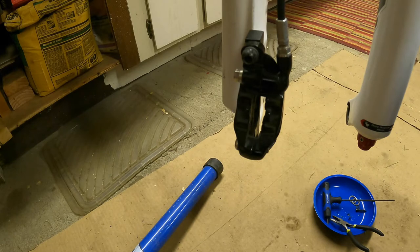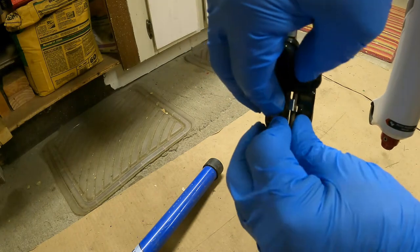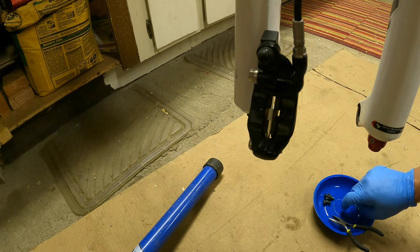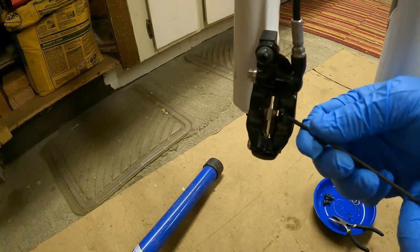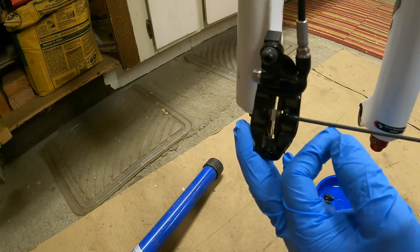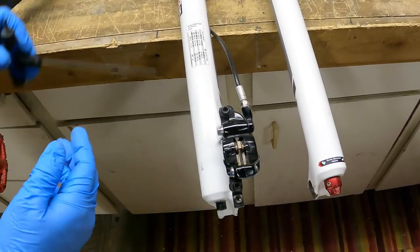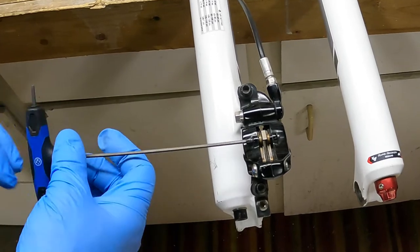Back up here in the front — I'm going to slide the pads right in there just like so. Wiggle them in so they seat. Then we are going to take our machine screw and our 2.5 millimeter Allen key and just thread that back through there. I moved the bike over here because I could not see what I was doing with the light — I was putting the screw in on the wrong side, so it's going in much easier over here. It should just glide right in there.